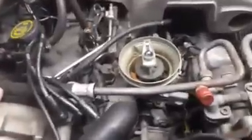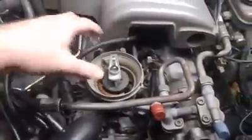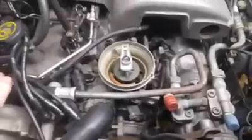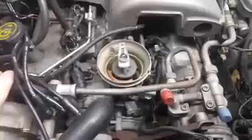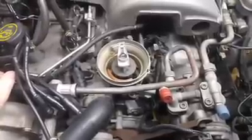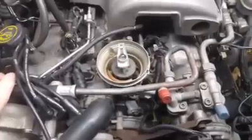I already put the distributor in. As you're putting the distributor down in, it's going to rotate to the right as the teeth of the gear mesh with the teeth of the cam. Make sure you put a little Vaseline or break-in lube or something like that on the gear of the distributor so that it doesn't run dry on oil when you first crank it up — that stuff will disappear quick once the motor runs.